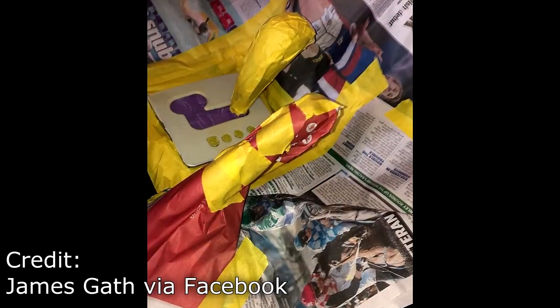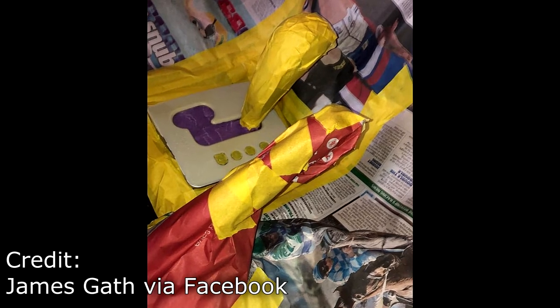As you'll see, recently on Facebook it has been done — I'll put up a picture now. You can in fact strip off all this old plastic, mask it up, and then very carefully spray it in the car. Plastic drop sheets would be ideal for helping with masking. I don't like that option because I don't trust my masking that much, and I think for the effort we'll get a much better result with it out of the car.